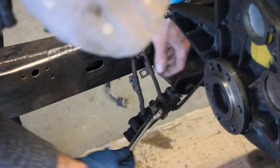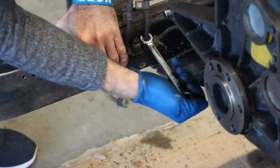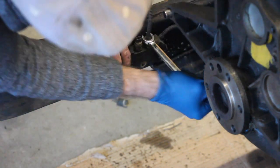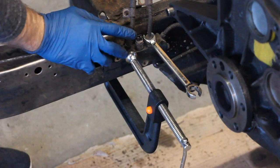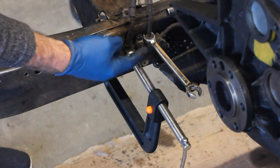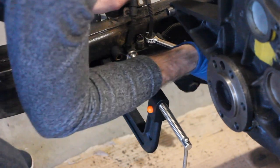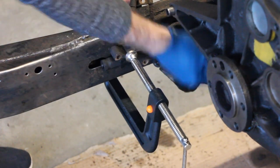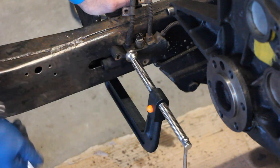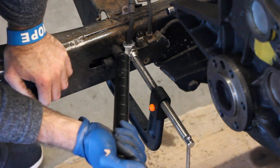If you get in here with a half-inch wrench and crack the tension on these guys — again, easier said than done, these things are on there. The two main lines: this is a quarter-inch line, this is three-eighths. The quarter-inch line, strangely enough, has a larger nut on it, so I guess that way you don't mix them up. The other nuts on here — so this one was a half inch, and these I think are seven-sixteenths. The other problem with the smaller wrenches is there's a lot less leverage on them.